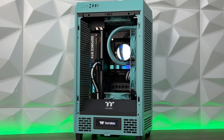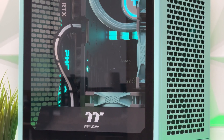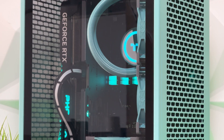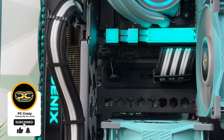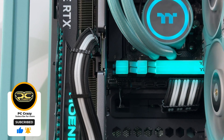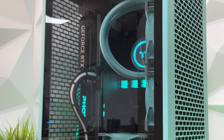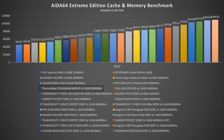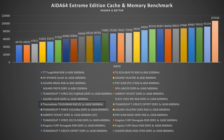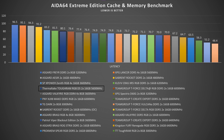Let's check the performance, starting with the RAM modules at 5600 MHz. In AIDA64 Extreme Edition memory test, read speeds went up to 58,893 MB/s, write speeds up to 75,238 MB/s, copy 58,718 MB/s, latency 80.1 nanoseconds, and the CL on these RAMs is 36. I'll also be doing another review with 2x48 GB Team Group T-Force Delta DDR5 RGB on this board, so subscribe and hit the notification bell so you don't miss that.